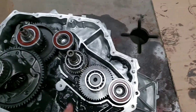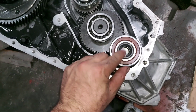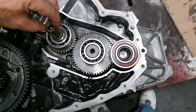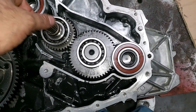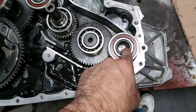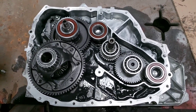Now let's find out the gear ratio between generator number one and the internal combustion engine. Taking our reference point here facing this gear — one... two point three. So it's 2.3 times. Every time the internal combustion engine spins, motor generator number one spins 2.3 times. There you have the gear ratios of this transfer case from the e-Power series.